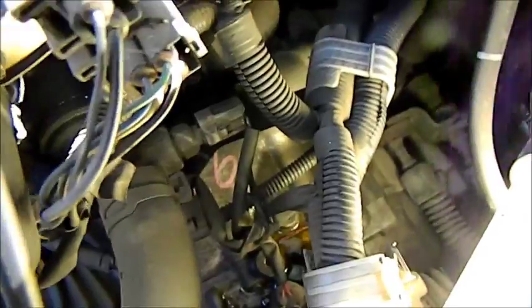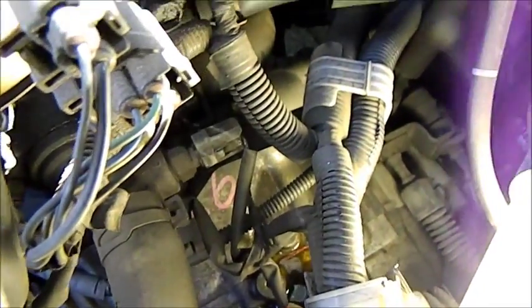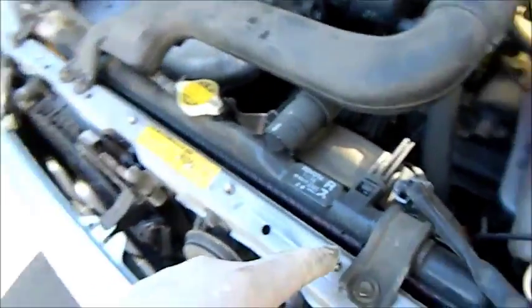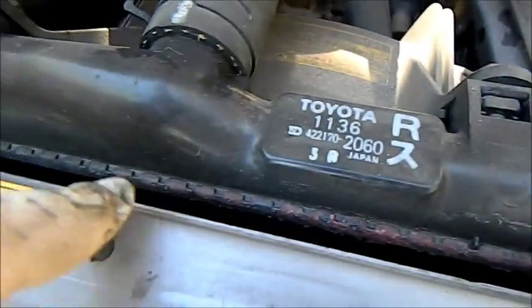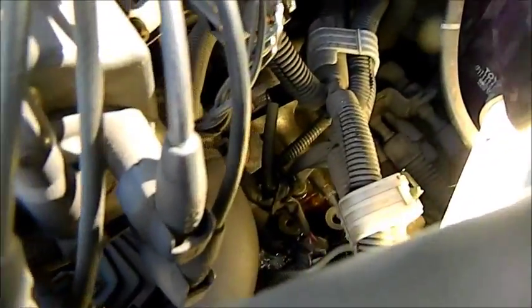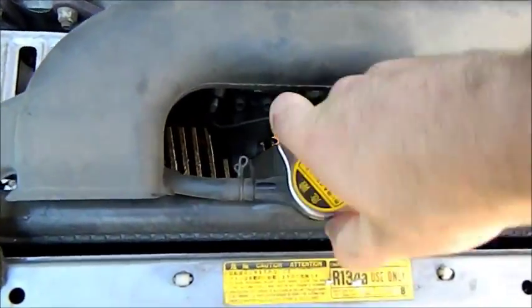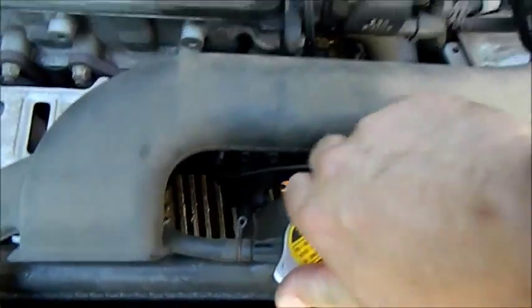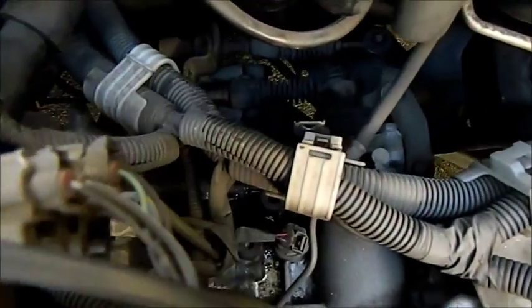I don't think there's anything wrong with this engine, but there could well be. It was diagnosed as having a possible head gasket issue, but I can't get it to fault. The top tank in the radiator's been weeping as well, so the radiator's buggered. It's also full of scaly stuff in the top hose. That hasn't been replaced in years and years. It's all crusty in there, so it looks like its cooling system needs looking at. And the other thing, the coolant's low, so whether the engine's been burning that I'm not sure, but if it was burning it shouldn't have a pool of coolant down there.